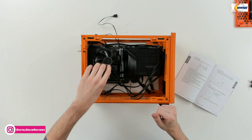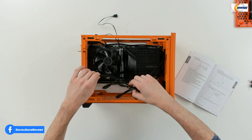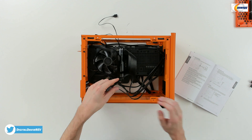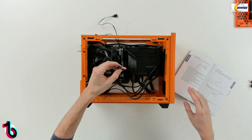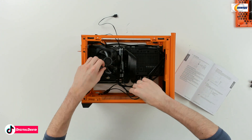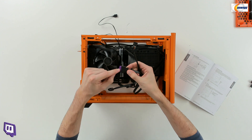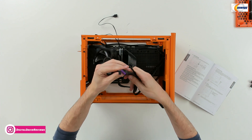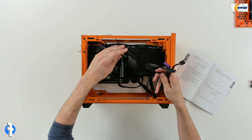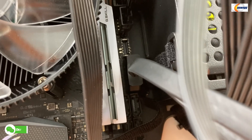Now we're ready to plug in the rest of our cables. We have our HD audio — that's going to go right here under this cover, which we may need to remove with the Phillips head screwdriver. We have our front panel connector that drops down right in here. Page 1-18 in the user guide manual will walk you through the correct setup for that. They have a nice cover on there keeping everything together. Then we have USB 3.0 for our front panel — pay attention to how the notch is lined up, it's only going to fit one way. I did have to undo that screw to connect the HD audio.